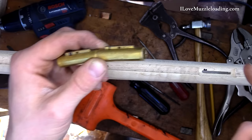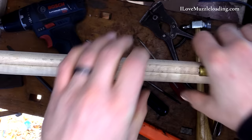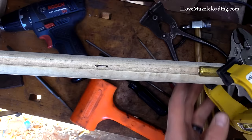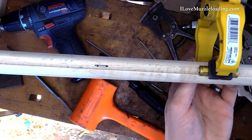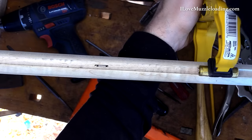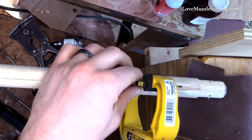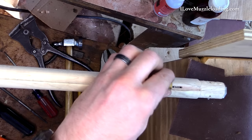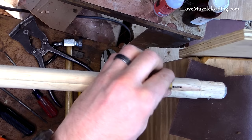And our two will be our rear end. To go along with that, I'm going to mark two and mark one so our notches will be to the rear. It might be kind of ugly but the pipes are going to hide that. I'm just pressing that down in there, grab a clamp, making sure to clamp onto our barrel. All of our pins have gone from side plate to lock. That looks like it fits, so we're going to move on.